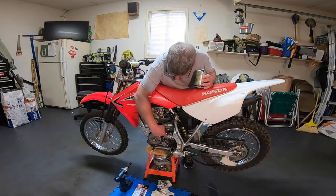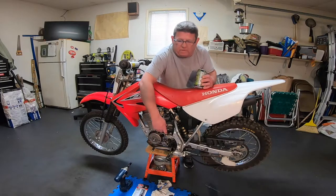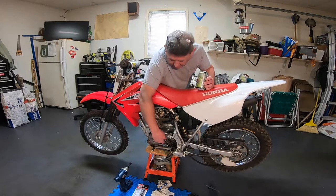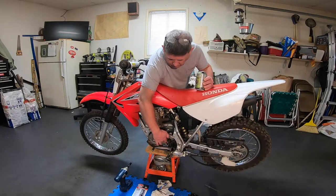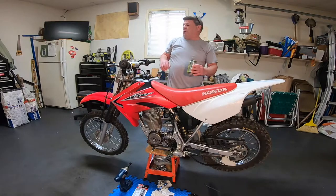I had a little chip — I bought it that way and didn't know what the piece of metal was in there. When I was doing a sprocket change I noticed it, almost like 'what the hell?' I went to check and it wasn't catastrophic. It didn't affect the housing that mounts the pickup, didn't get into the crankcase at all. It's just a little chip where the flange comes around, and unfortunately that's where the gasket is — where moisture can get in, and dirt and mud can be slung in by the chain. So I'm gonna try a little repair today, we'll see how she goes.